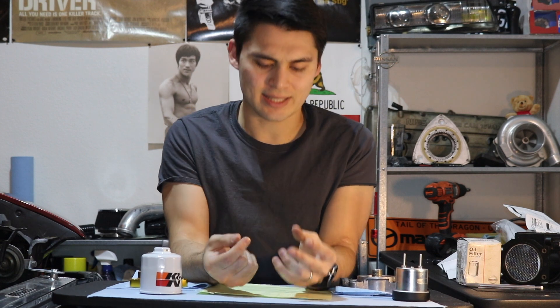That doesn't really happen very often, but the same thing can happen with high engine speeds. Your engine is pumping up so much oil as it's revving at high RPMs that there's just so much volume that the filtration media has a hard time passing through to lubricate your engine. So when this happens, the bypass valve opens to let some of that unfiltered oil through so that the engine can stay lubricated.